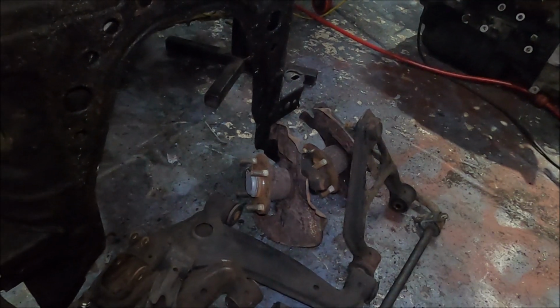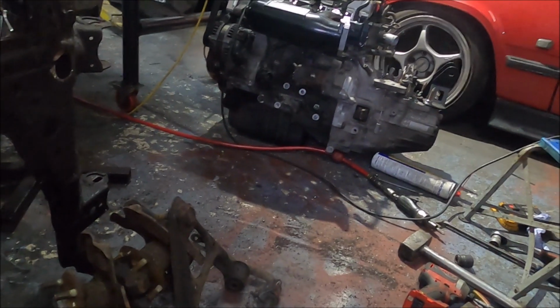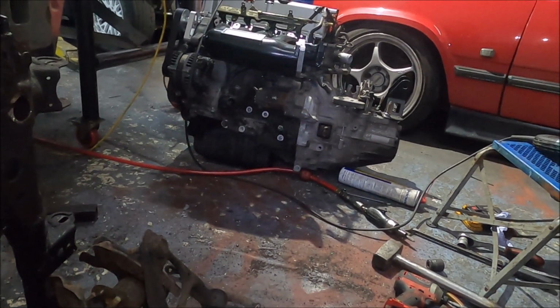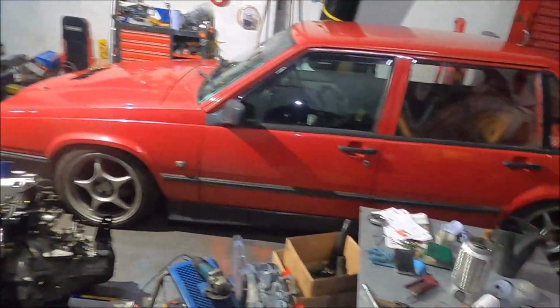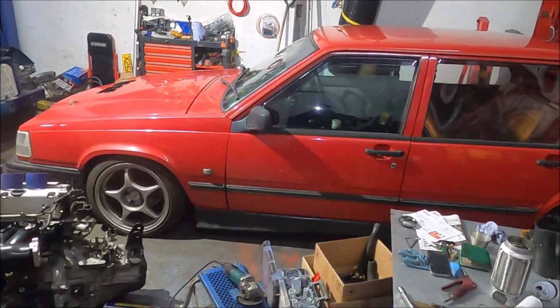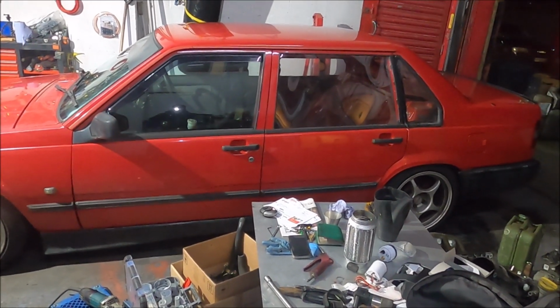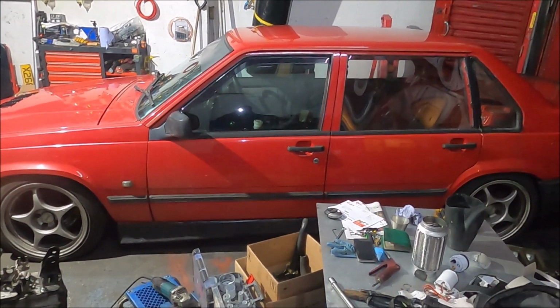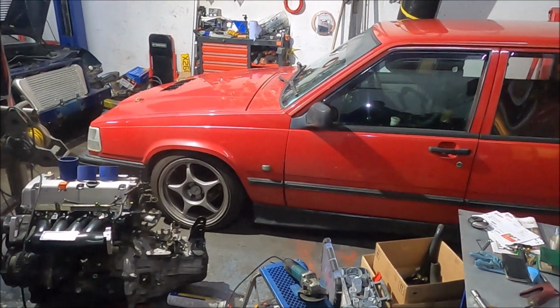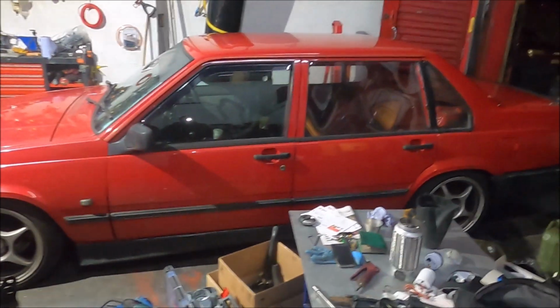I don't want to get rid of Ackerman, because no Ackerman is shit. The Volvo's got no Ackerman, and I don't like it. I like cars to sort of drive like race cars first, drift cars second. Too many people make drift cars drive like shit in a vain attempt to make their drifting less sucky. For me personally, learn to drift better. You know, compromising how a car handles just so it handles better mid-drift actually is just terrible.